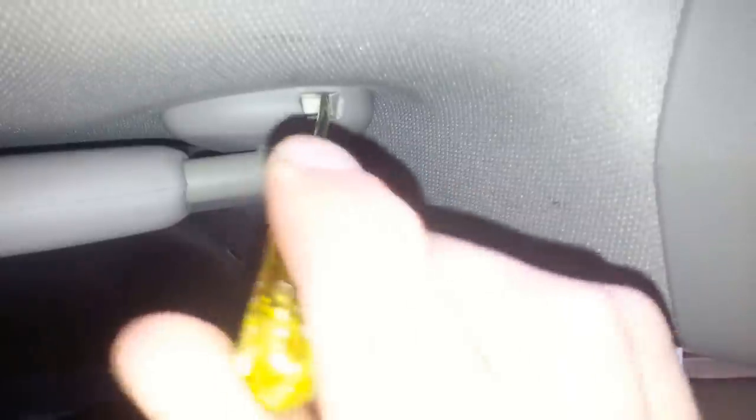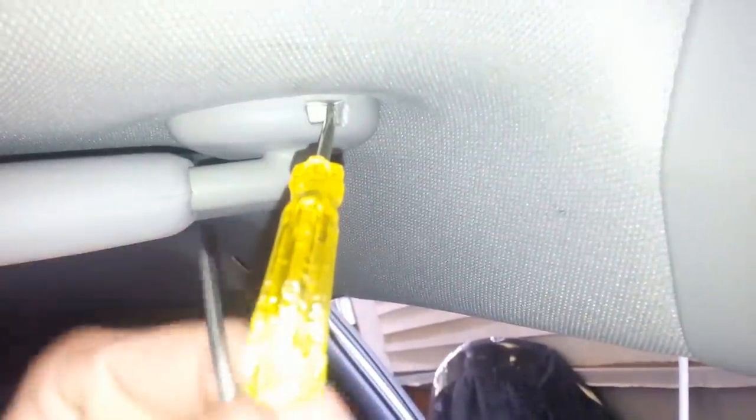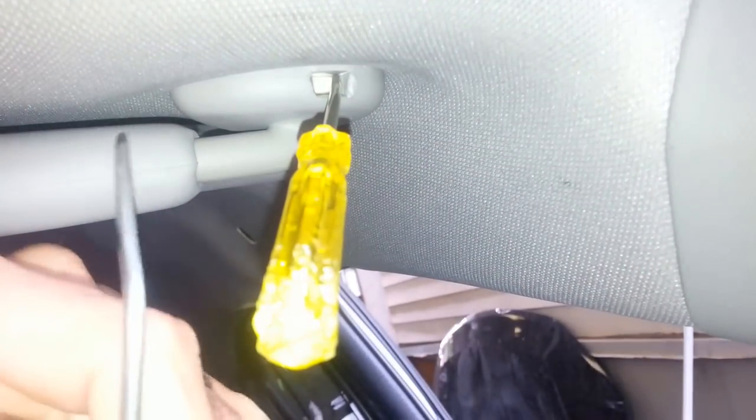Already doing it. Now this one is going to be on the opposite side. If you notice, there's a little crack in there where I've already been working it. I'm going to wedge it in there — I need to get it way back there. The problem you're going to be facing is that the other part of this clip right here is going to have a little edge that's going to be catching, so you won't just be able to pry it open. I recommend getting another screwdriver, and if you need somebody to push this in while you crank it with your other screwdriver, go ahead and do that.